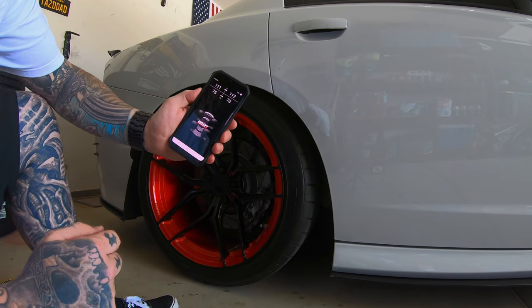That looks pretty good to me — riding about an inch and a quarter low. We'll check the same thing from this side. I'm happy with it. It's about an inch and a quarter drop, which is what I want. As I'm driving, I can always drop it further when cruising into car shows — usually a full two and a half inches, basically where the fender's right on the tire. But you don't want to drive that low all the time, especially if you're already tucking — it limits your steering ability. Don't set your ride height so low that the front tire is tucked in the fender well, or you'll damage the fender when you turn. I like about an inch and a quarter to inch and a half drop.